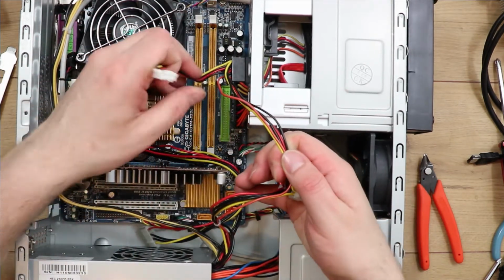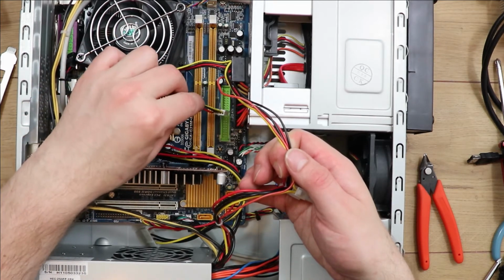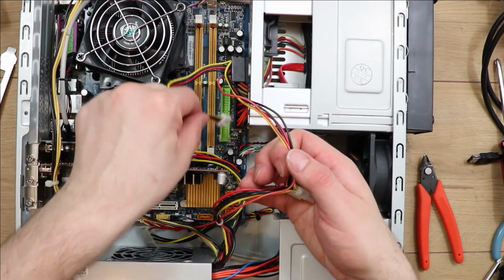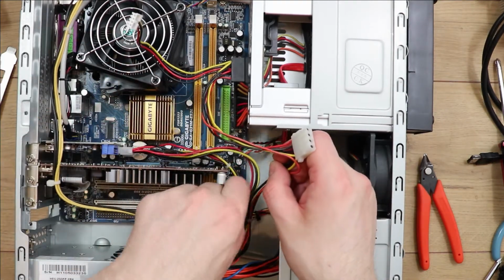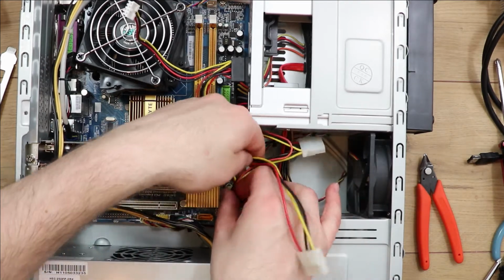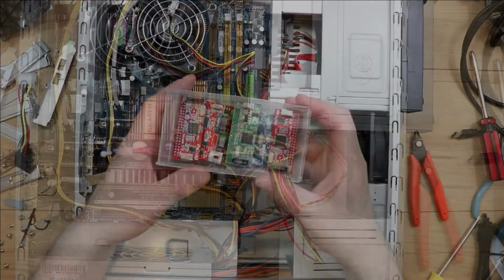And then the 3.5 inch floppy cable is probably going to be used to power an IDE to SATA adapter that will go straight in there, so that puts this in the right place where it needs to be, and again it leaves us with a free Molex connector in this vicinity that we can use for whatever else we need. And I'll probably somehow tie all this lot together just so that it's neat and solid and doesn't move about.